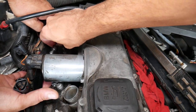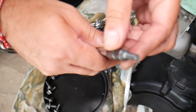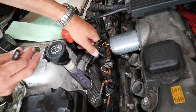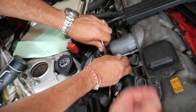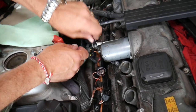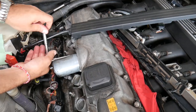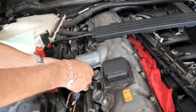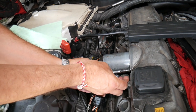Got the first bolt out — two more bolts and one wire to disconnect for the valvetronic motor. There is another gasket here — if you have a valvetronic motor, replace this one too. That's a weak spot. If you notice engine oil leaking from here or pooling in the spark plug pockets, it could be from the valvetronic motor gasket. Always replace it when you replace the valve cover gasket. I'll put the link in the description below.